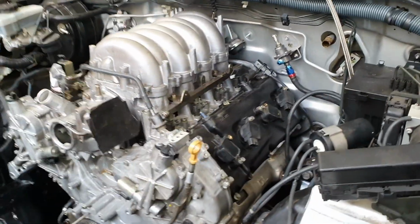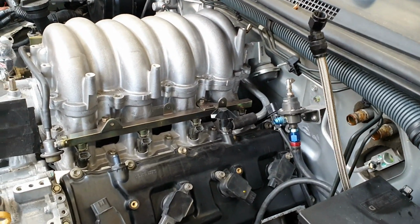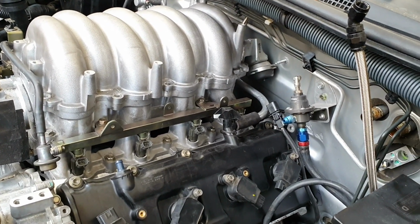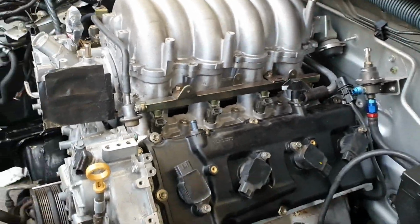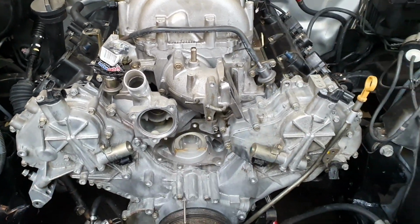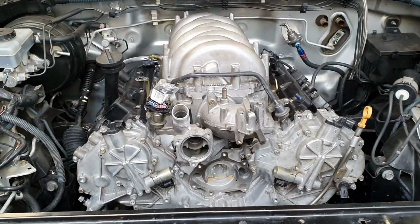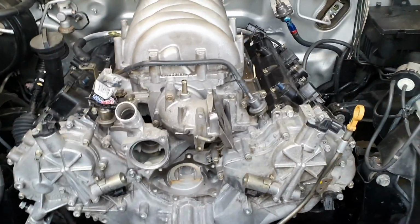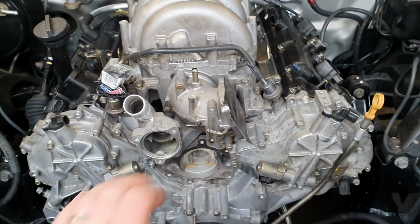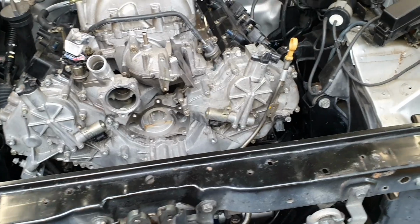Right, it does physically fit, so that's good. Kind of thought it would, but we are quite close at the back there with that diaphragm to the firewall, but conveniently there's a little bit of a dimple there in the firewall, so it's not bad, not terrible. It's about where it sits. It's not quite 100% right at the moment. There's a couple of shims that go under the left hand side here to square things up. I got a little bit wrong when I made the engine mounts for it, so there's just a couple of shims that go in there. It does sit slightly skew around that way in the chassis. That's pretty much the only way I can make things work with the components that we've got.